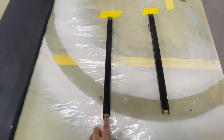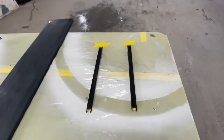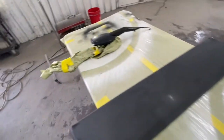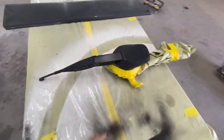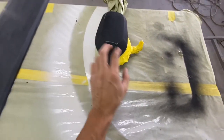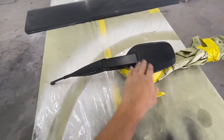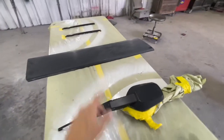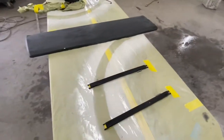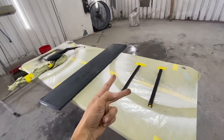I went ahead and put some tape under these and taped off the edge a little — just so they don't blow away since they're very light — and they are wet sanded. Same with this panel, nice and wet sanded. The windshield wiper I masked off all the mechanical mechanisms and then wet sanded. I hit up Georgie and he actually did want the whole arm painted. I found the bracket I was missing in the engine bay area, snapped it on, and sanded everything. So we are painting the whole arm, that whole panel, and the two trims. Everything is wet sanded — going to wax and grease remove it and start shooting with two coats of base and three coats of clear.